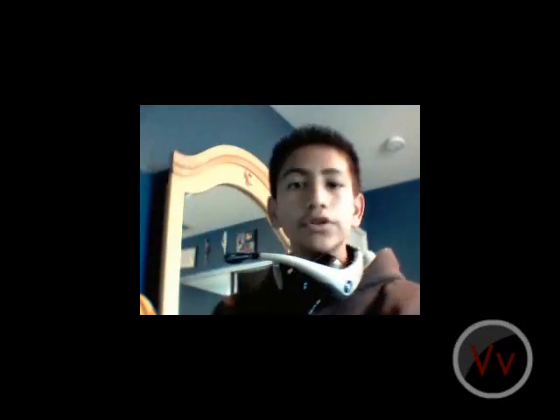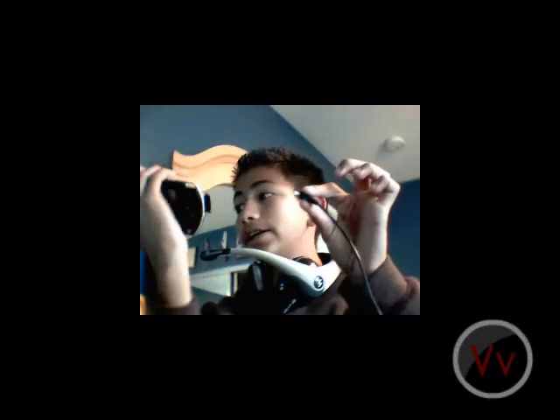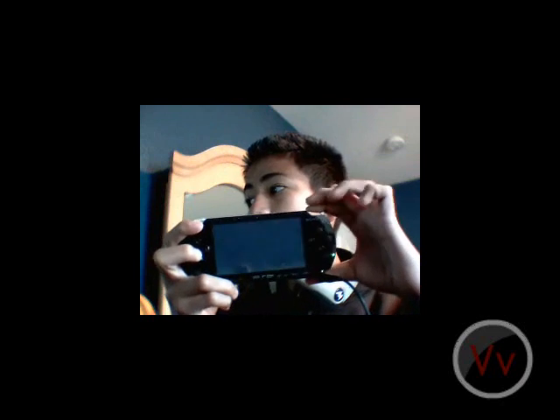Now we have all the files onto our memory stick. Press O to get out of USB mode and turn the PSP completely off. Take the battery and the memory stick out - so now you just have a stripped PSP with no battery and no memory stick. Get the PSP charger and plug it in. This will only work with 3.71M33. To go into recovery mode, power on the PSP and right away hold this trigger - the R trigger right here.